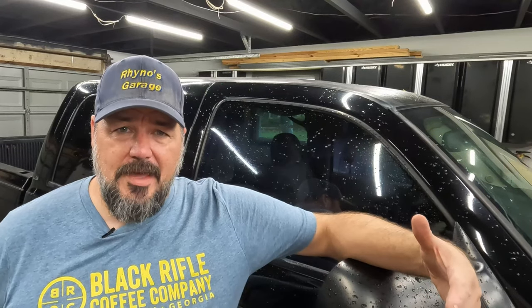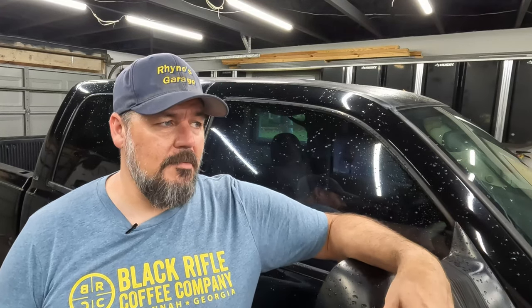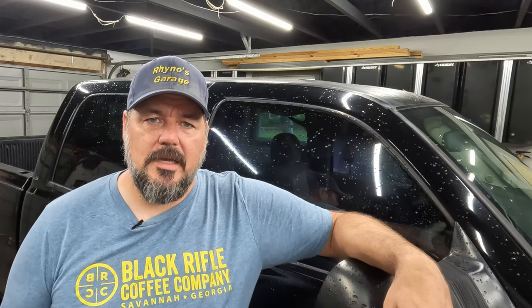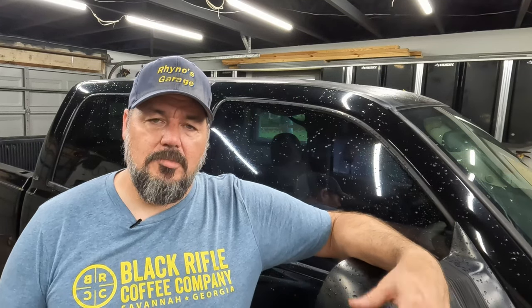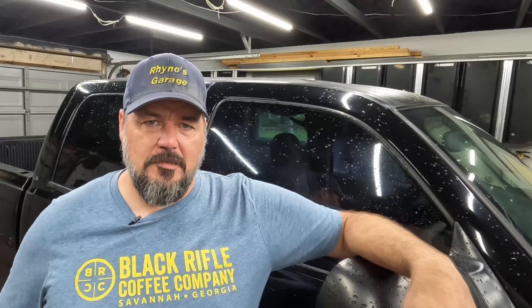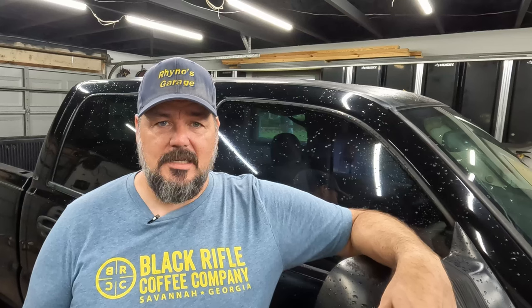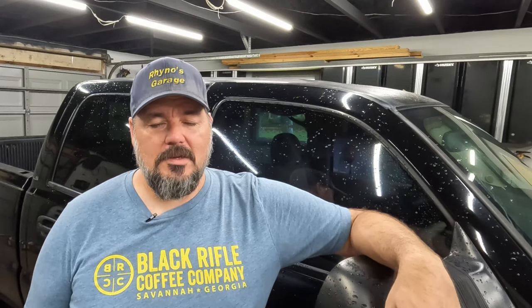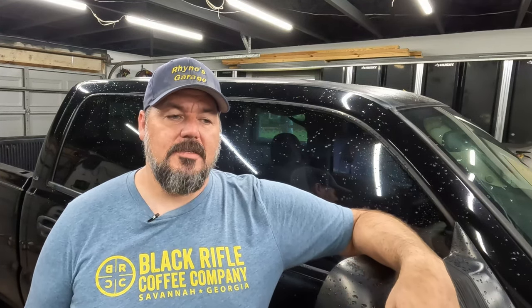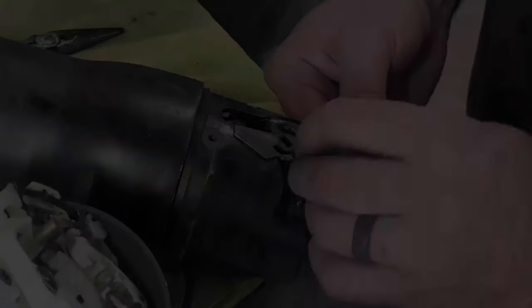So I want to repair that before I put a new headliner in there and just ruin a new headliner. I'm going to get this one out, and we'll go through that process. Then, probably in the next video, sometime next week, I'll get a new headliner put on the backer board. I'll show you how to do that and put it back in. They're kind of clumsy for sure. It's hard to get them out once you get it removed from the ceiling. In fact, I think the easiest way to get it out is through the passenger side, and probably without the seat in. I'm going to try to get it out without taking the seats out. There's a lot of panels to take off and a lot of different pieces. So it's going to take a minute, but we'll get to it.